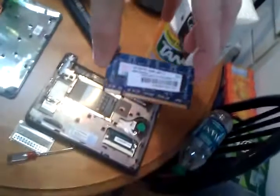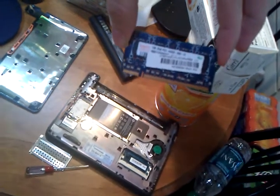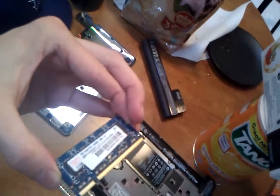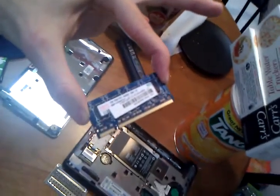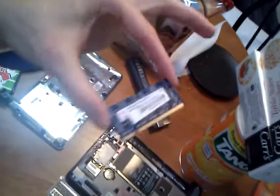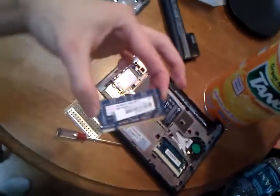This is actually my first time taking this thing apart. I just knew how to take the back off, so as you can see it's very simple. PC2-6400 is what is compatible. If you want to make sure what is compatible, you can go to Google and search 'HP Mini 110-3098 RAM Upgrade' — it should bring you to Crucial.com. I'll include it in the details of this video. It's going to tell you your RAM upgrade options. From that website, you're only allowed to put in a 2GB stick. If you're able to put in 4, I don't know if this is a 64-bit processor — I don't think it is. I'd just stick with 2.